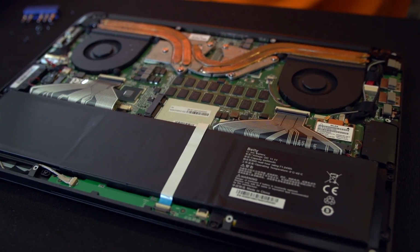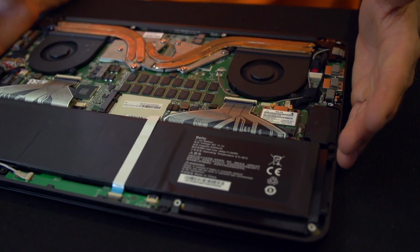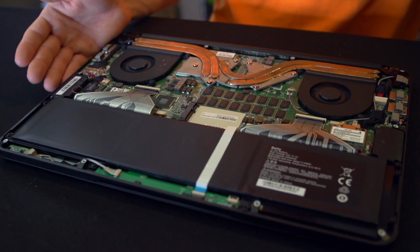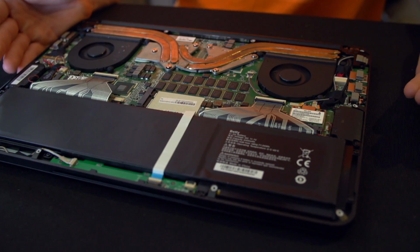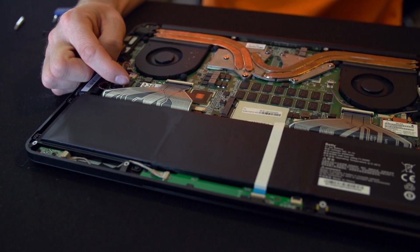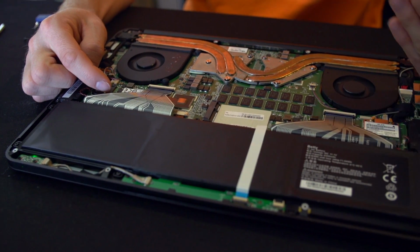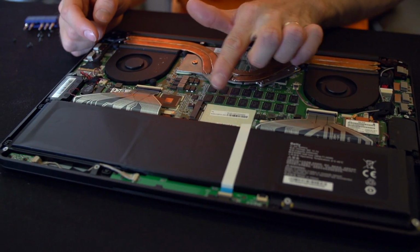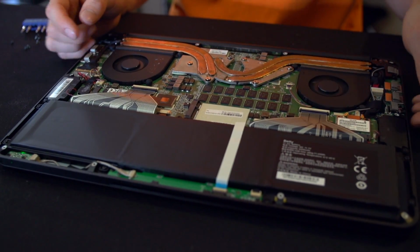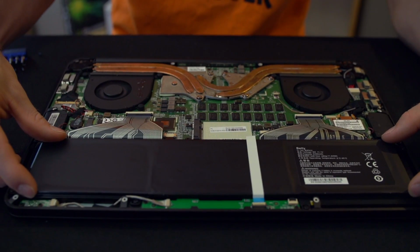And I kind of went, well, no, I don't really think so, because the level of integration that's going on here is outstanding. Plus, there are some things that you can do here that you can't necessarily do with every MacBook. So for example, there's an mSATA SSD. So the SSD is actually upgradable. Now, while you can't necessarily upgrade everything, you can see all the DDR3 memory is soldered right to the main board. You can change your wireless chipset.